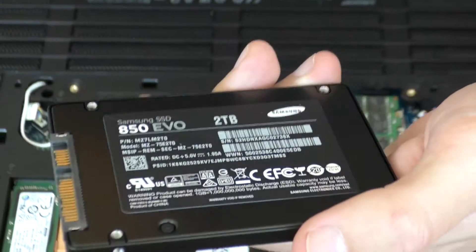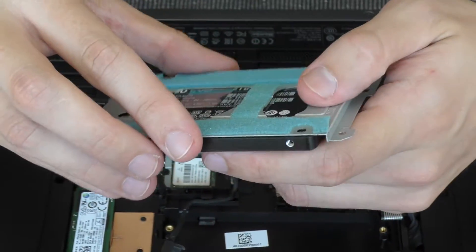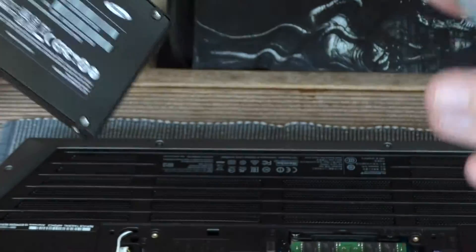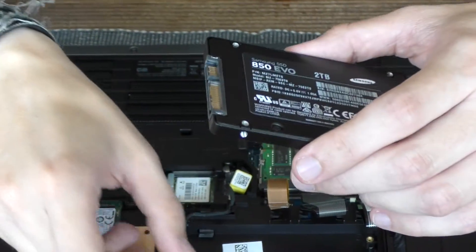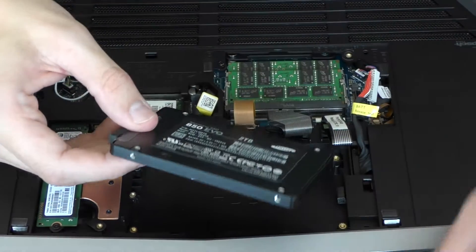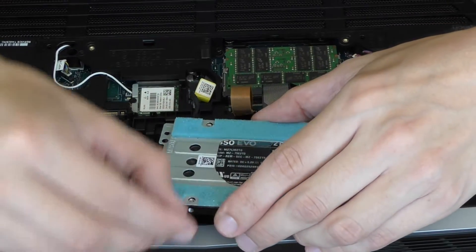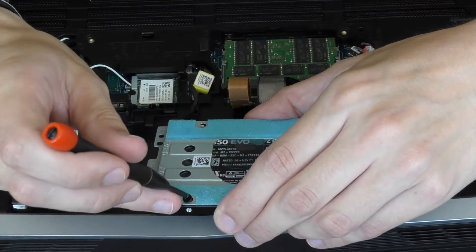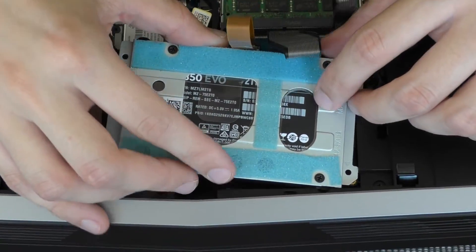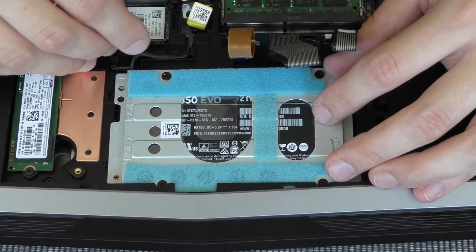The question is now how do we put this on. We will screw the plate back on here, but first before we put this on, we have to put the cable on, because later we won't have any chance to put it back on. So we got the cable back on, then we insert the four little mini screws again, and then we will insert this SSD back into its place.